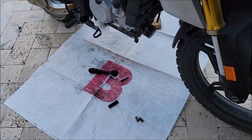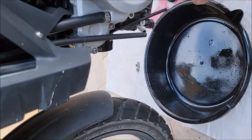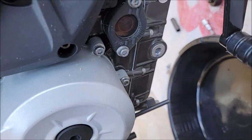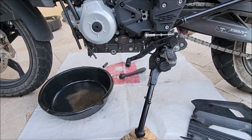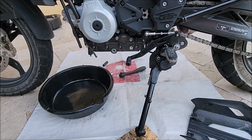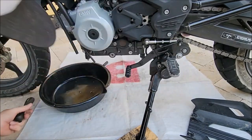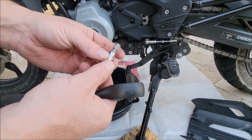On the left side of the bike is the oil plug. You have a hex 8 for the drain bolt, and there I'm just checking the fluid oil window just to see what it looks like before I remove the oil. I already heated up the bike for a few minutes — here's your hex 8.